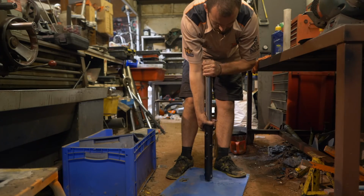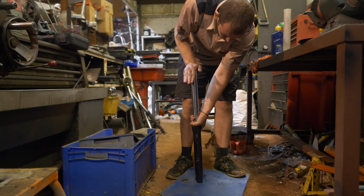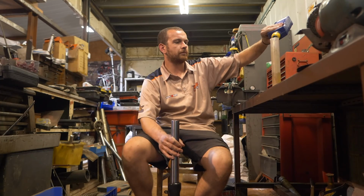Okay. And you're just trying to make sure there's as little air as possible in the oil that you're putting in the bike. So you took that total capacity and broke it down into, I think, three sections, and you just poured it in each section. So I generally stop after every 150 mil just to make sure that there's smooth action on the fork and there's no excessive bubbles. You can look down the top and you'll see it's got a bit of foam or something like that if it needs going more. What you're looking for is, like I said, smooth action and no gargling. You don't want any gargling sounds or hissing or anything like that. And you saw yourself, once we'd done it a couple of times, it was nice, quiet and smooth.